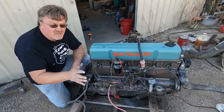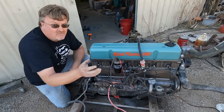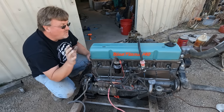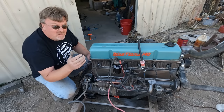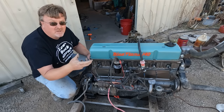Now I've hooked up everything else, including the fuel pump. I don't know if it works, but I hooked it up and we got a clear filter, so we'll see if fuel pumps through it. I've got the alligator clips back on the ignition. We're pretty well set. Now I don't like running these motors without water in them. They don't heat up instantly, but you get localized hot spots. The water inside is meant to even out the temperature, not just keep it cool.